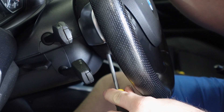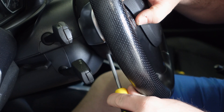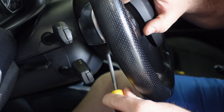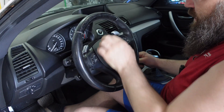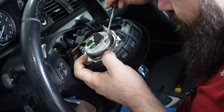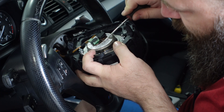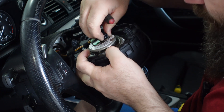When we went to remove the airbag from the steering wheel we just ended up using a number two Robertson. I find this works best because it ends up pushing against the spring and it doesn't slip off. It's going to take some time so be patient, and once the airbag comes out use a pick or something to pick up these clips on the back of the airbag. And if you haven't already, unlike Taylor, make sure you disconnect the battery.